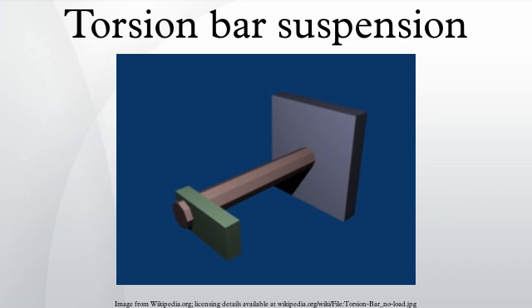The main advantages of a torsion bar suspension are durability, easy adjustability of ride height, and small profile along the width of the vehicle. It takes up less of the vehicle's interior volume than coil springs. A disadvantage is that torsion bars, unlike coil springs, usually cannot provide a progressive spring rate. In most torsion bar systems, ride height may be changed by simply adjusting bolts that connect the torsion bars to the steering knuckles. In most cars with this type of suspension, swapping torsion bars for a different spring rate is usually an easy task.